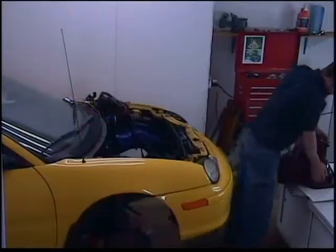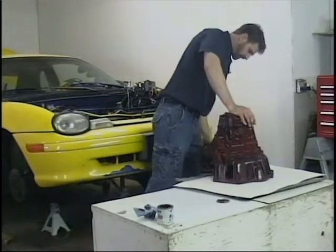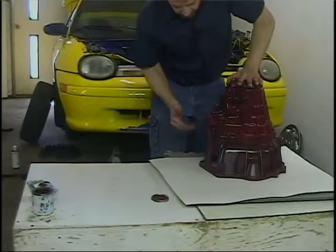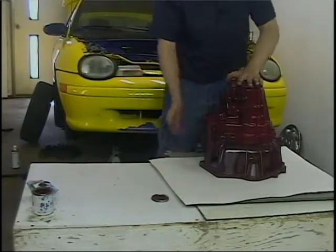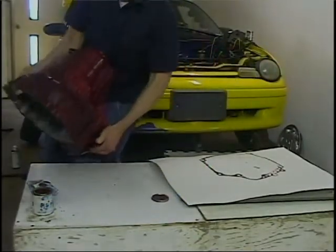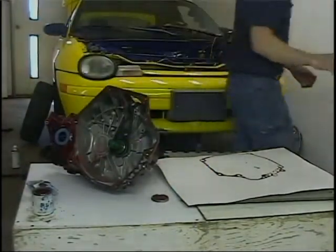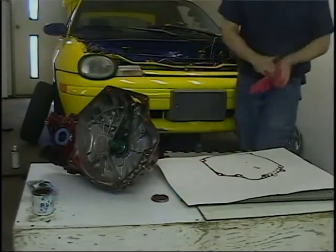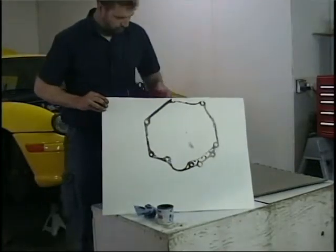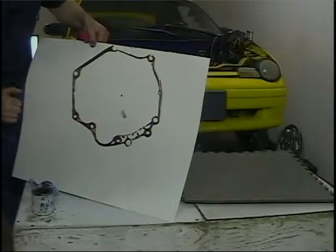I am going to push all the way around, pushing into the foam so I get good transfer. Once that is done, I will try to lift straight up and remove the transmission to see what we have. I also purchased a set of basic mechanics tools. Since most of today's automobiles use metric and standard sizes, this was a good investment. There is nothing more irritating than spending time looking for tools, so I made sure my work environment was set up so I had access to what I needed. What we have is a good transfer — a nice pattern all the way around. The center of the transmission is also there, which is very critical.